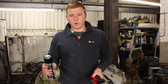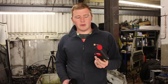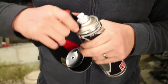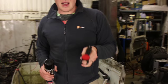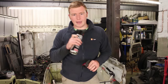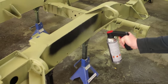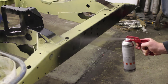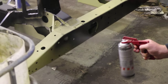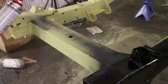Because we're going to be using aerosols for quite a long time — there are a lot of nooks and crannies on the chassis — it's well worth getting a can gun. It clicks onto the top of the aerosol tin and gives you an adjustable grip which you can squeeze; it's very ergonomic, lets you do half pressure on the tin, and stops your finger from cramping up. Whenever you're spraying with aerosols, maintain that 15 to 30 centimetre distance — it allows the paint mixture to disperse properly so you get a really consistent, even finish and are far less likely to get runs in the paint.